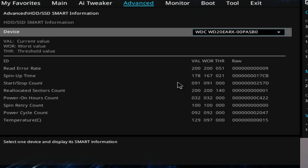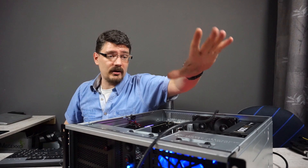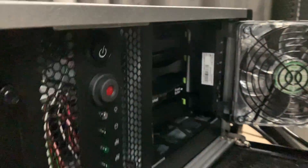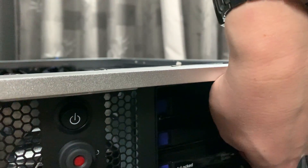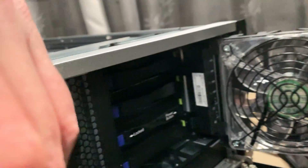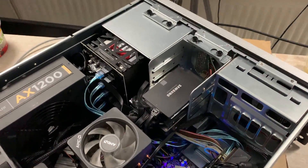Let's see the SMART information. We have one green drive, the Transcend SSD, the 860 EVO — that's the caching SSD — and another SSD, the Western Digital. So three of these four drives don't work — this is kind of silly. Right here is a little switch, and apparently that's the on/off button for that specific hard drive. Each slot has its own power button, and that was causing the hard drives not to show up in the BIOS and RAID. They were just powered off. I totally missed that.